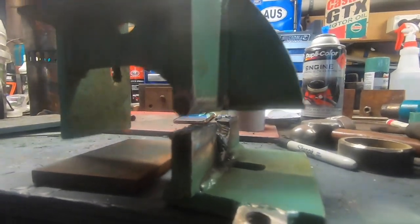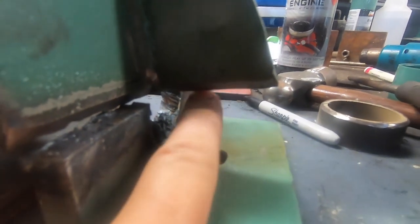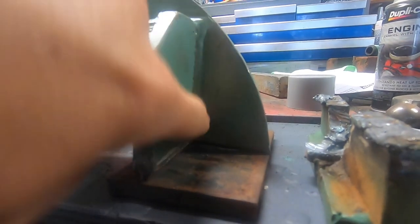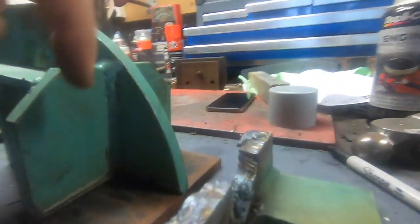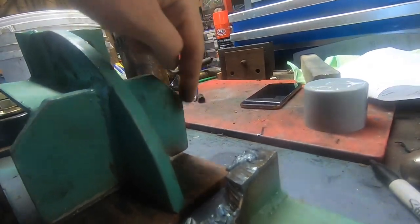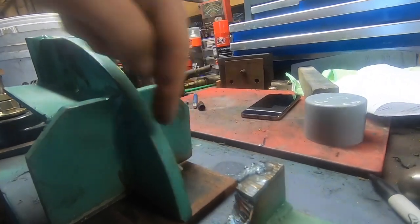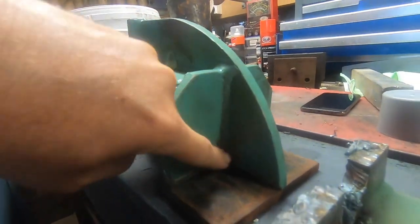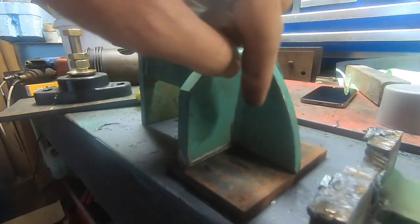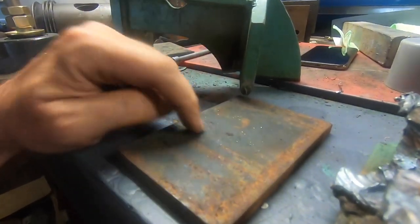Here's the deal with this engine mount. Cut 40mm off. The bolt head used to come through here and there was room. Now there's not - the bolt will just hit here. So I'm going to plasma cut this flange off and offset it, bring it out to here. I can't have a flange both sides of the bolt because there's a part of an oil cooler that kind of sits in here. So we'll cut this off, reattach it over here, and drill the hole in the base plate for the stud before we weld it on.